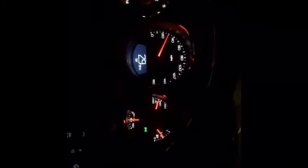All right, so I got all the brake stuff put on, and I have broken in my brakes, which consisted of going 45 miles an hour and hard braking to 5 miles an hour, and I did that 5 times, and then I went from 35 to 10 5 times at medium braking. That's what the brakes came with instructions for, and that's what called for me to do. If it does not call for instructions, I usually go from 60 to 5, about 10 times hard, and then about 5 times soft, about 40 to about 10 to 15.